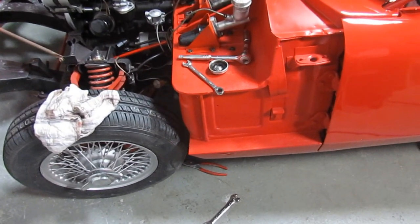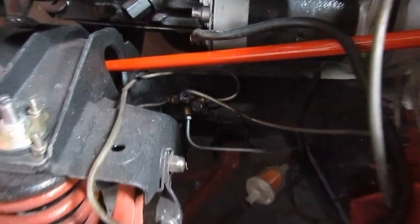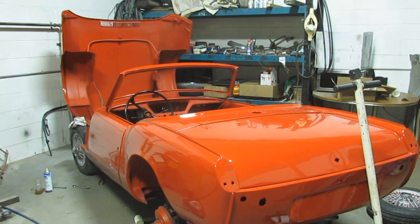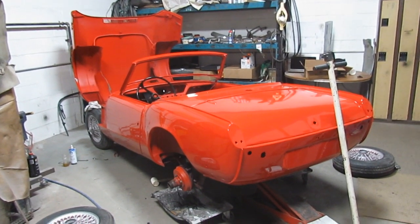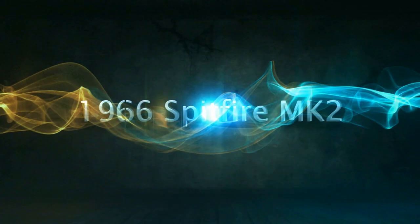All the process is done again and the brakes are bled. I'm surprised I was able to bleed them all by myself — that was thanks to Carlos and his trick. Now this four-way connector is completely dry, and I don't see any other leaks anywhere. The three-way connector over here is also completely dry, and all other joints everywhere are completely dry. I'm going to keep checking over the next few days, but I believe the brakes are complete now. Next thing is to start the engine and drive the car — this time with brakes. Can't wait for this moment.